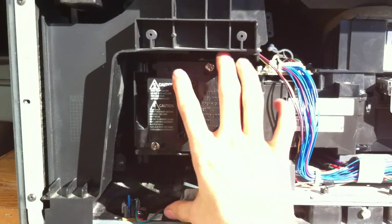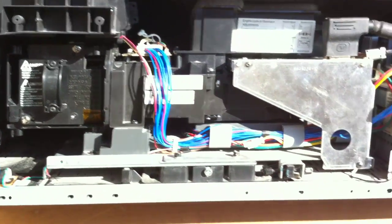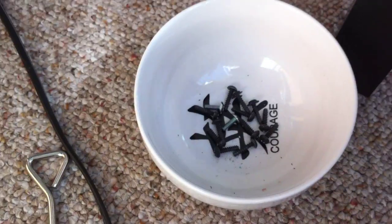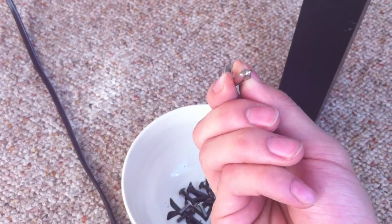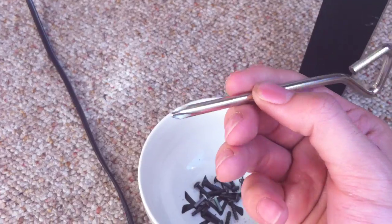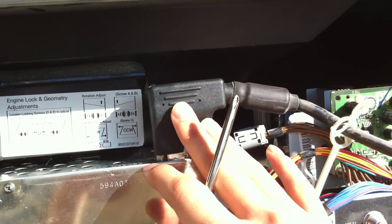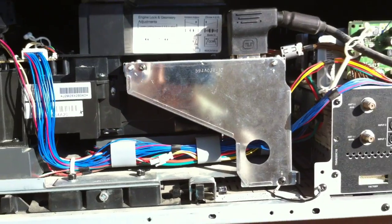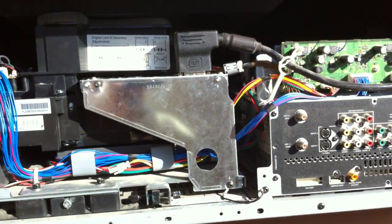Remember, if you're just changing the lamp, it's this guy right here — do these two screws, pop it out, pop it back in, you're done. There's all my screws; I think there's 14 in there. This is the only tool you're gonna need — a screwdriver. Actually, to get that DVI switch out, my screwdriver was too big, so I used a kitchen knife. Anyway, let me get this off — take these screws out and then I'll show you removing the engine.